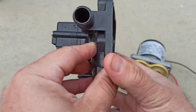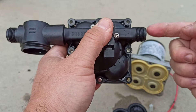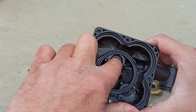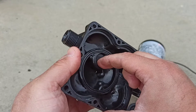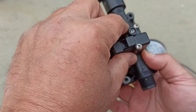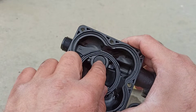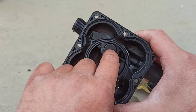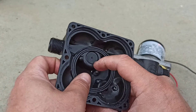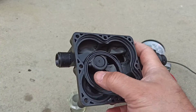One potential cause for my particular problem of water backflowing through the pump is that the water pressure at campsites was too great — it was pushing back into the pump and forcing its way through this check valve. This is the location of the check valve inside the pump housing; it's a spring-mounted little button. If a little bit of debris gets through your strainer, into and through the pump, and gets caught in the check valve, that allows a gap for water to come back through to your fresh water tank.